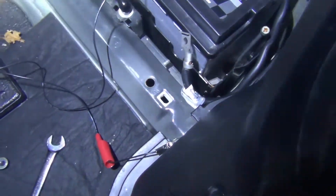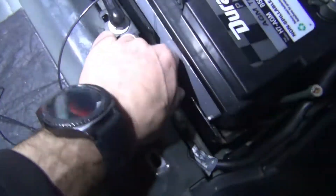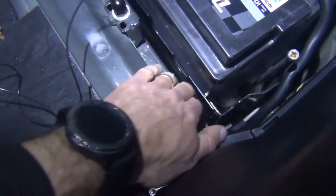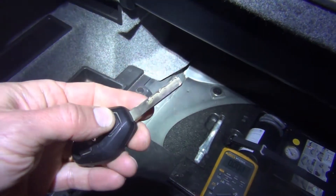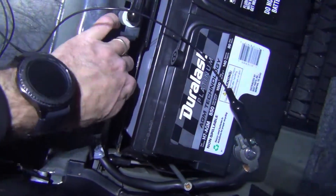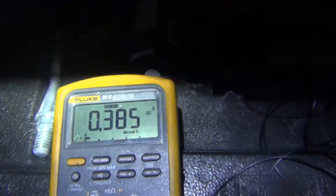What I'm basically going to do is wake up the car. But what you don't want to do when you wake up your car to recheck your values — you don't want to leave your ground off. You don't want to go through your meter with a high amperage spike because that can actually pop the fuse in your meter. So I'm going to go ahead and just loosely put my ground back on, which will allow the voltage to go through the chassis ground instead of through the meter. So that when I wake the car up — my lights flashed, my fuel pump turned on, it's still running. Okay, wait for that to shut off before I disconnect this, and then we should see a big change in the amperage drain.